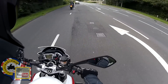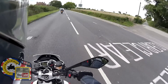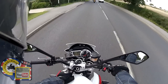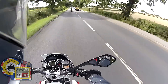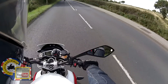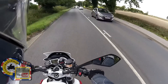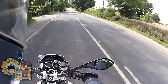One thing I must mention — this is the third Triumph I've ridden now with tightened steering. It's almost like the factory have over-tightened the steering. It needs loosening off a little bit because once you've been out for a faster run and you slow down, you can actually feel it weaving; the steering's too tight. So if anybody from Triumph is watching, can you please comment — it's now the third new Triumph I've ridden where the steering is too tight.